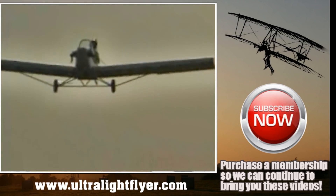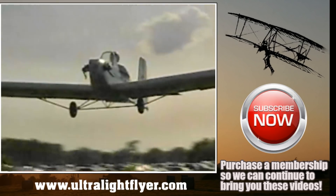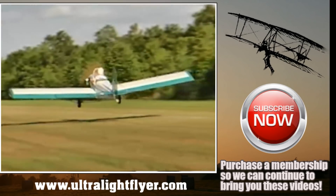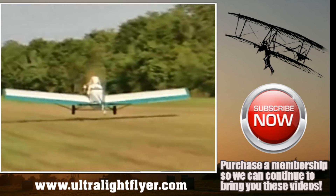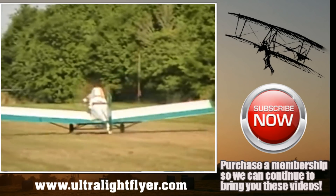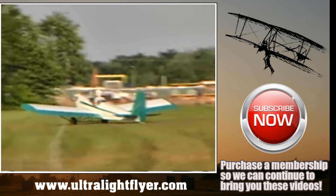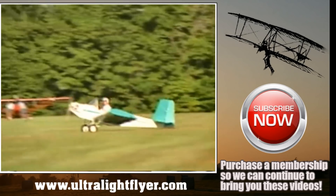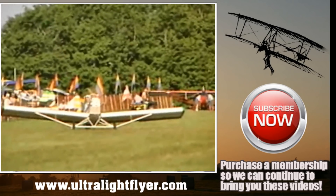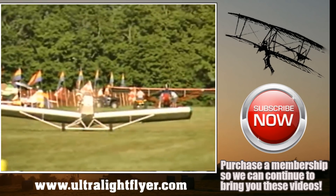You've got this thing all built now and you go to put an engine on it. What type of engine have we got? We have a Hummel-designed half-Volkswagen. It was built at home — not at Hummel. We bought the plans approximately 10 years ago. The engine is 94-millimeter jugs with a 69-millimeter stroke, and it's got an updraft Zenith carburetor. It's a little sweetheart — it runs great.